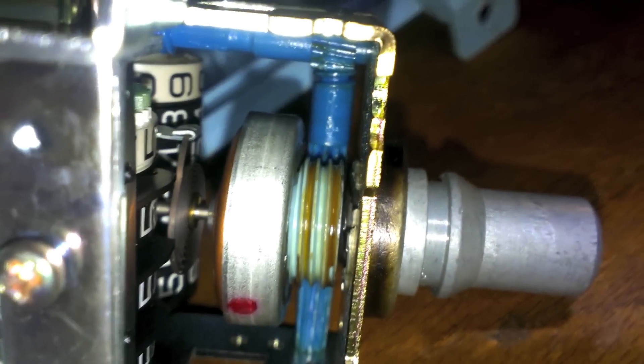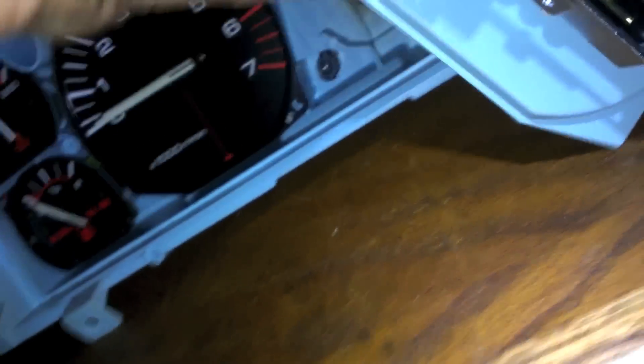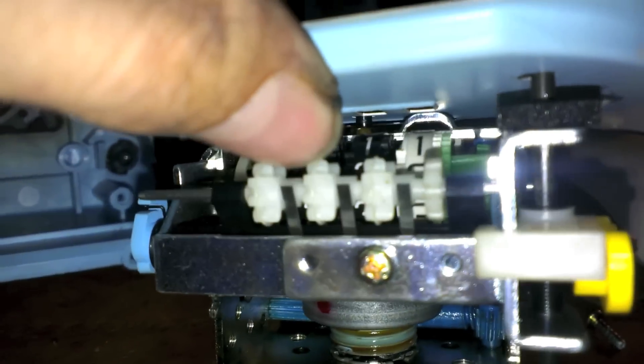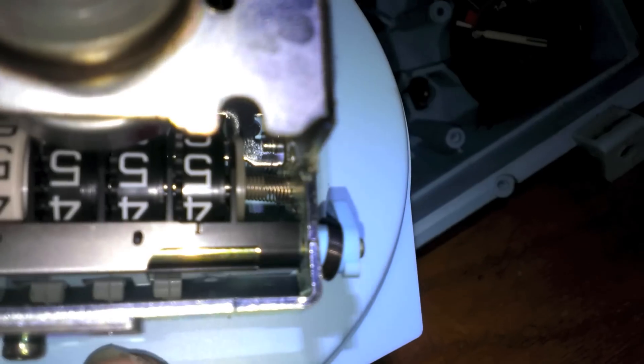If you notice, there's a worm gear that connects directly to the speedometer. So when the speedometer spins, it spins this piece and that piece, which controls a lot. There's also a trip reset meter with a little spring action. When you push the reset button, those little gears release and all spring back to wherever they belong. You can see the spring right there holding tension.